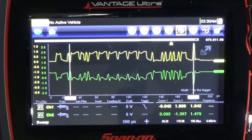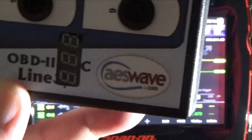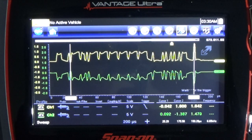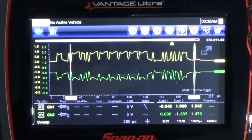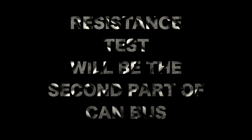Using this tool — you can get it from aeswave.com. It's not cheap, it's a $200 tool, but it's very useful when you have CAN communication problems. We're facing this problem all the time now with new cars. In another section I want to show you how you measure resistance using a regular voltmeter, and how you do it.